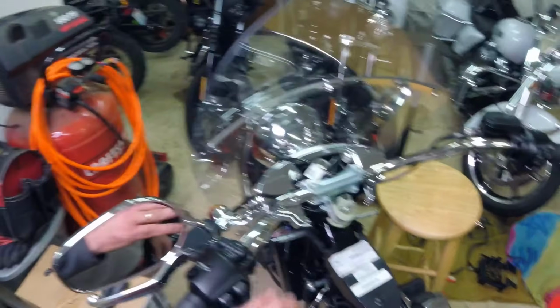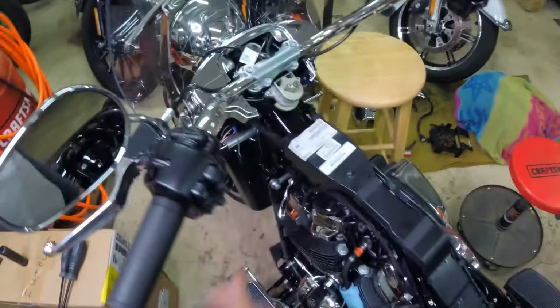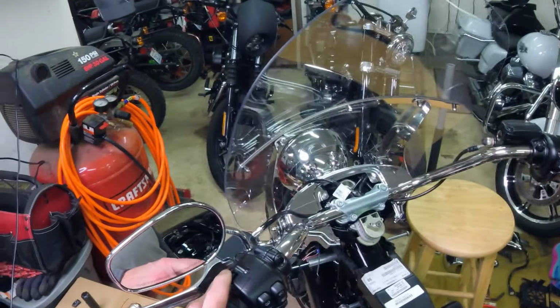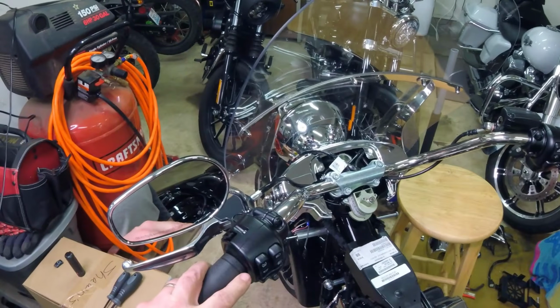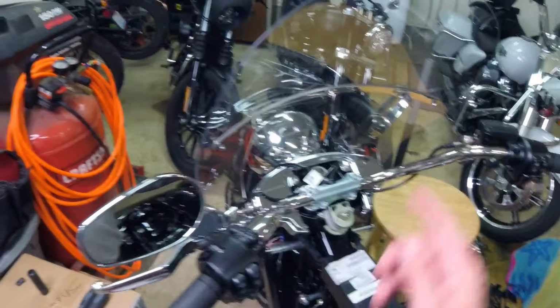Nice thing is there's no hydraulics. I can just let it lay wherever, as long as it don't hit nothing, like bang the fender down there or something. I don't have to worry about getting air into the clutch master cylinder, because it's a cable. Alright, so I won't go through the boring stuff of unbolting this. I'll come back when we're pulling stuff through. So there's one thing you need to take note of.